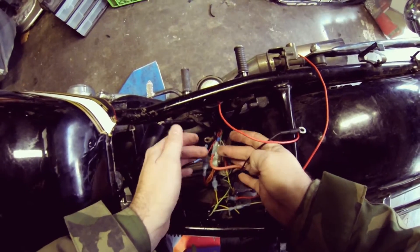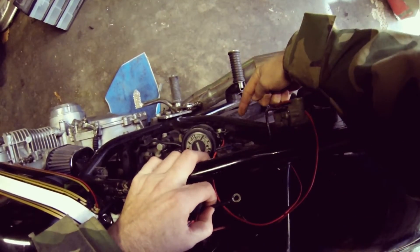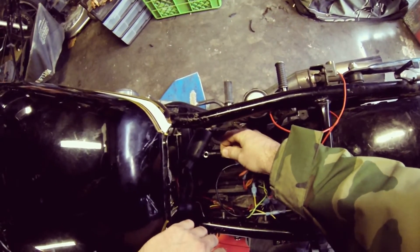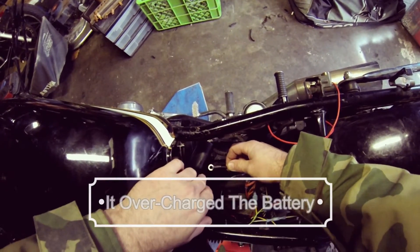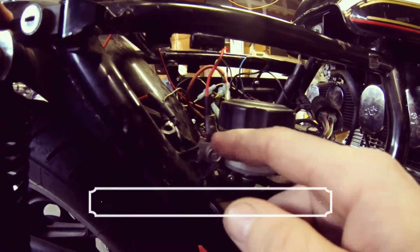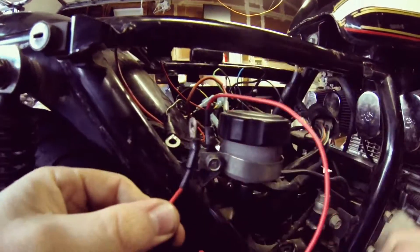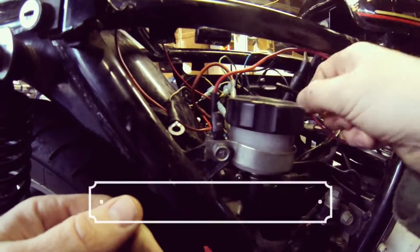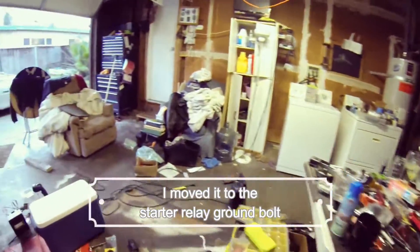I should have done this sooner but for now I'm going to leave it because I just want to get the bike going. This is your black wire — the meter. It used to be connected to the brake sensor, but now I put a little connector on it so I can put this on the positive terminal, because it's going to read directly from the battery. Some people on GS Resources say it's going to draw power from the battery, but we'll see over time. I also added an extra ground — I grinded down the metal here, placed a wire with two different leads on it, bolted it to that ground, and bolted this to the negative battery terminal, just to get a more solid ground.